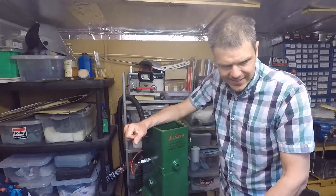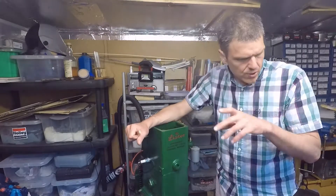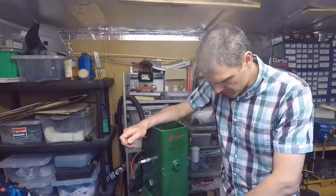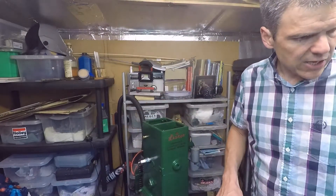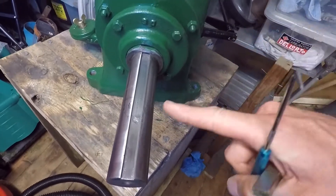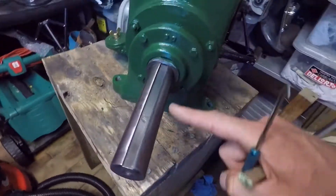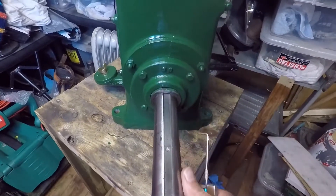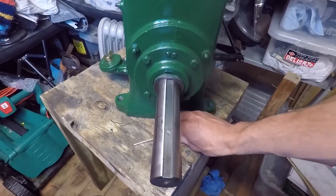I'm going to smear this in oil and WD-40 so it's well lubricated. But one of the things I need to show you is all the things I've done to get to this stage, because the flywheel was a bit damaged. So let me show you a close-up of some of the damage. Here you can see this bit here, and around here also there is a little bit of damage. What I had to do is polish as much as I could with sandpaper.